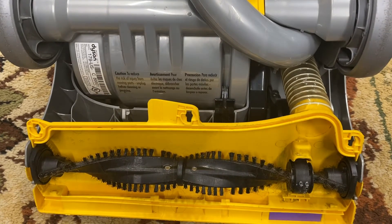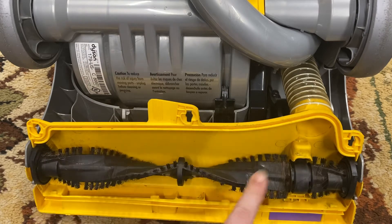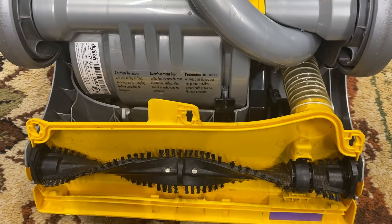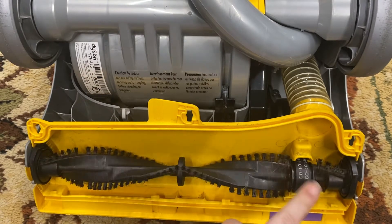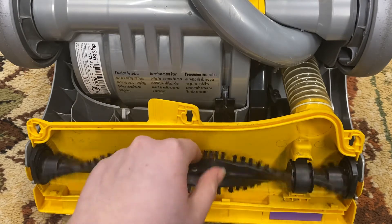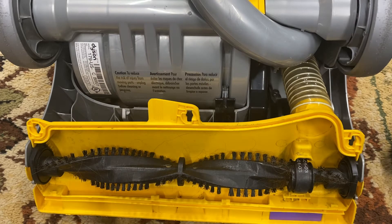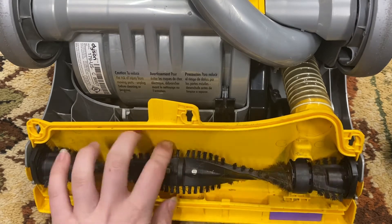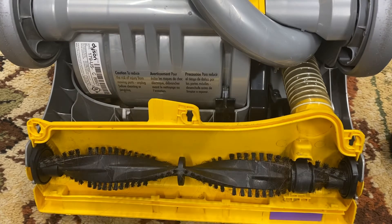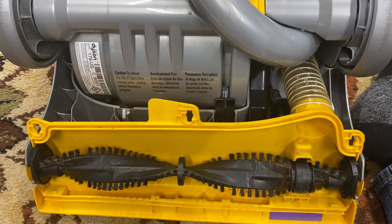Remove your base plate and here's the brush roll. If you're replacing the brush roll, you might want to replace the clutch too — the clutch only lasts a maximum of five or six years. Brush rolls usually last seven to ten years. It wouldn't hurt to replace the clutch; it's about twenty-eight dollars and will improve performance. But do check for that ratcheting sound first.